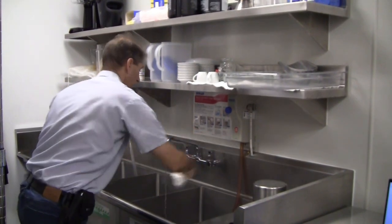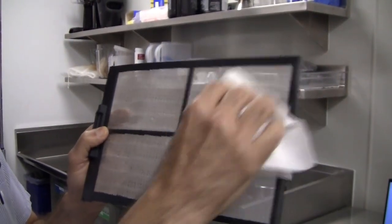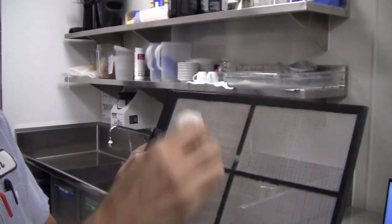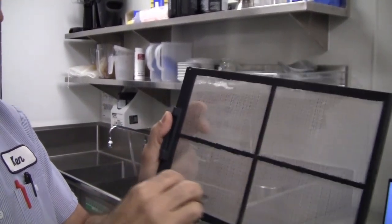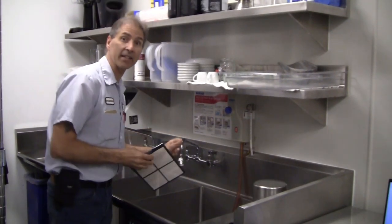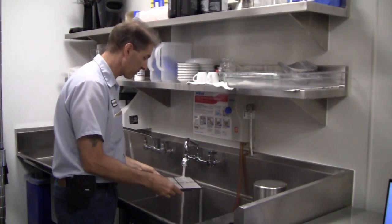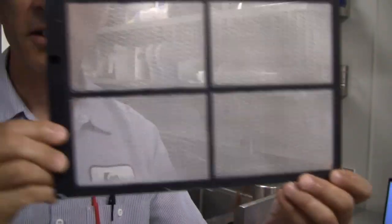For the air filter, I'm going to take a paper towel, put a little bit of water on it to get it slightly wet, and just capture the bulk of the dust collected on the air filter, then throw that in the trash. Then I'll take it to the sink and put some hot water through it to back-flush it. Here's the air filter all cleaned up — I'm going to put this in the sink and let it dry out.